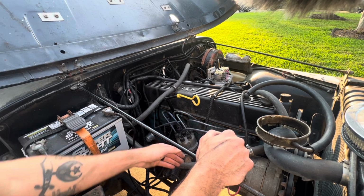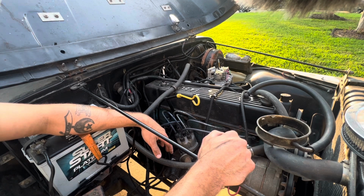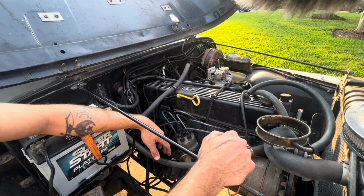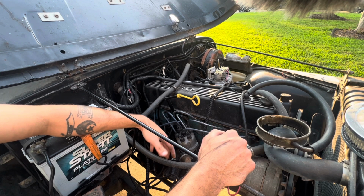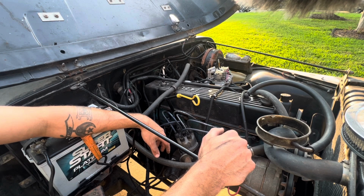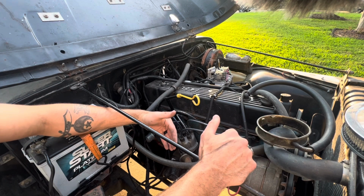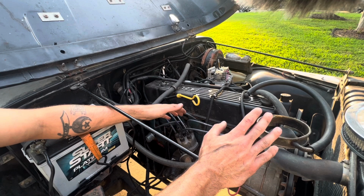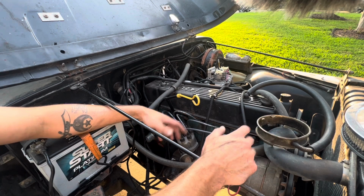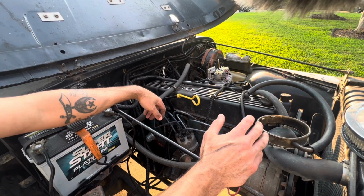So what I chose to do was the Nutter bypass. This is a method that has been used for decades at this point. I've done at least 4 of them, and to be honest with you, I've never had a problem with them. A lot of people complain about the old Ford ignition box there on the driver's fender, and say, oh, I need to upgrade to an HEI, and realistically you don't need to do that. Technically the HEI is an older design. Yes, it's simpler, it's tried and true, it's proven, but that Ford, I think they call it the DuraSpark or something like that, that ignition system has been around for decades now.